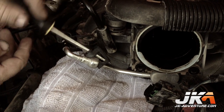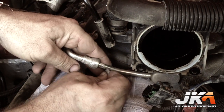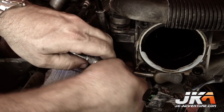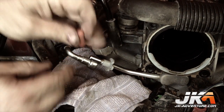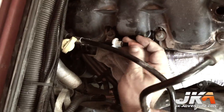Remove the fuel line safety clip and use the provided fuel line removal tool to remove the fuel line section between the barb on the fuel manifold and the hard barb near the back of the passenger side of the engine. This is a very simple process. Cover the hose end with the provided cap, then do the same on the other fuel line connector.